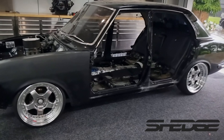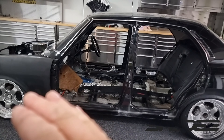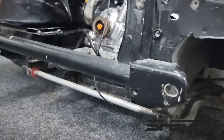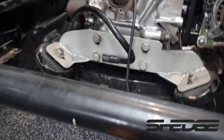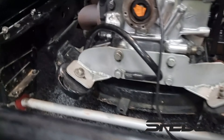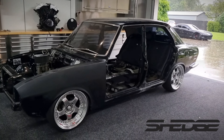Overall, really dry car — great starting base for a project. We've obviously got to remount the gearbox; we're going to get a new gearbox in shortly, so we'll be remounting the engine as high as we can go and then sort all of our driveshaft angles out. We're going to be making a whole new gearbox tunnel in the back. I should have had it up on the hoist so you could see that banana cross member — that's probably the lowest point of the car, so I want that raised right up. And get rid of this ugly engine mount — I just want to clean this whole front up. If we raise the whole motor up it should give us ample clearance because I want the underside to be about 50 to 70 millimeters off the ground.